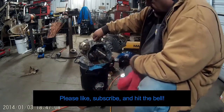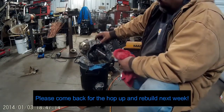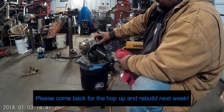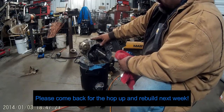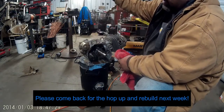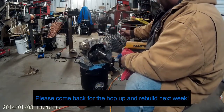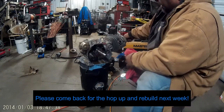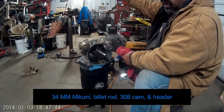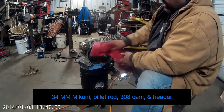I don't remember if I used 7/16 or 3/8 fittings here — this has been tapped and blocked off. After thinking about it, I've decided I would like to put a brass 90-degree elbow here and run this to a puke box as the return. And the puke box from the valve cover — since we're putting a Mikuni on it — the hose will be vented down to atmosphere in most applications, but I'm going to run it to the puke box as the supply, and then the return back in the top of the block.